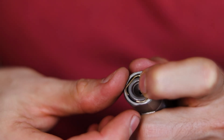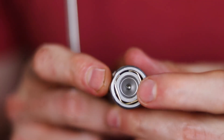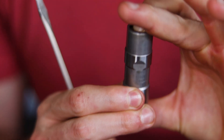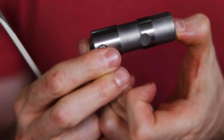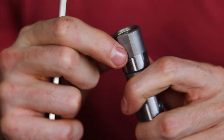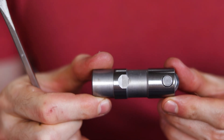We're going to take this piece and set it directly on top, like that. Then we put the little safety clip in there — this part can be kind of a pain but you just have to work it in as best you can. I find using a screwdriver also helps. There it goes. Now we have it in there and we have a solid lifter — there's no play at all, no movement.